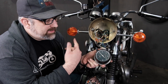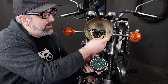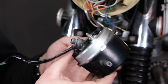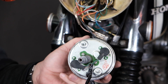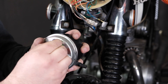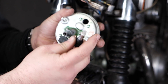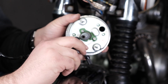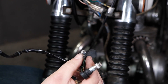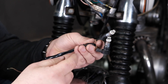We tested our gauge bulbs using the existing 12-volt positive black wire and our ground — jumping the brown and white wires into the 12-volt positive black to see if the gauge lights kicked on. This one was good, our taillight kicked on, but this gauge did not, so we need to get deeper into it. We can see we have our brown and white wire and our green ground wire. This one splits into two — this particular gauge has two bulbs, though sometimes there's one and sometimes two. These rubber sockets wiggle out to pull out the bulb. Someone has put an LED in this one. Let's take the other one out — I bet there's an LED in here too.